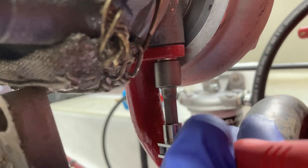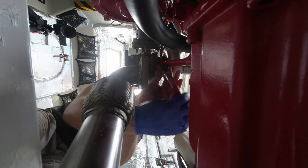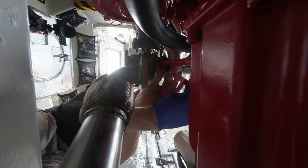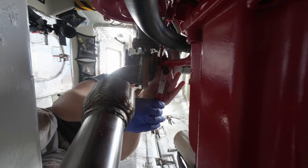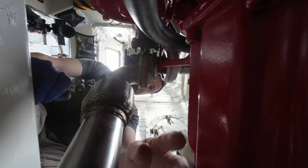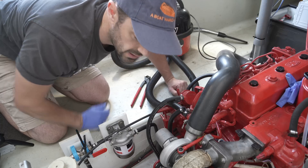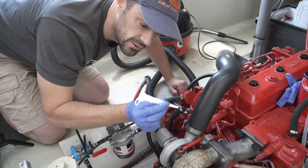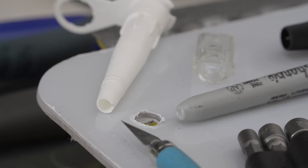The first time I tried, somehow the little green gasket shifted off centre, so I had to loosen and try again. Before tackling the final step, I was advised to do a little top-up of oil so that there'd be minimal chance of a dry zone within the turbo on the first engine restart, and before the engine oil pressure had risen and oil begins circulating properly. What I don't have is a correctly sized funnel in order to get oil down into the turbo. What I do have is a load of spare sealant gun nozzles, so I will chop the end off and that will work. God, I did sound confident.